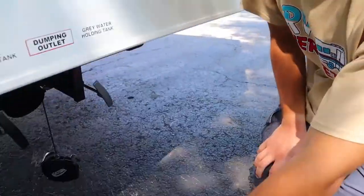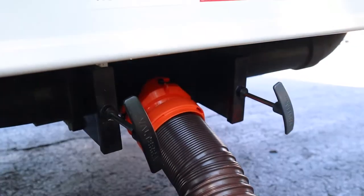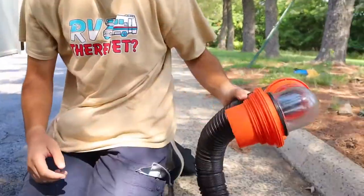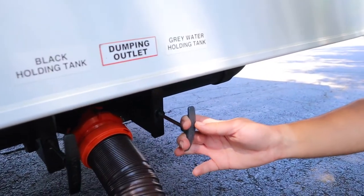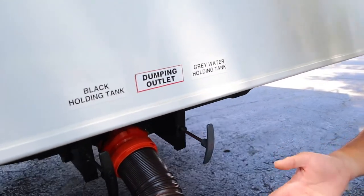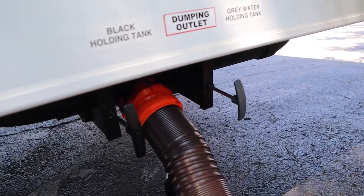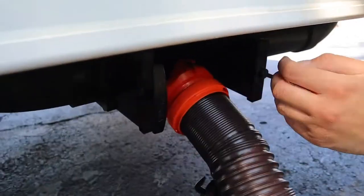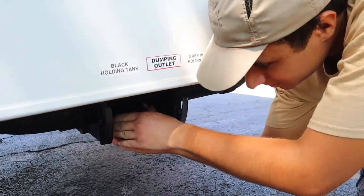Next to that you have the bag for the waste hose, which you will use to dump out the waste tanks. In the back here is your dumping outlet — this is where you dump out your gray and black waste tanks. Take your sewer hose, take the part with the teeth and flip it on clockwise until it snaps on. Then take the other half with the 90 degree elbow and stick it in the ground at the campsite or dumping station. You have two color-coded valves: the gray valve for your sinks and shower, and the black valve for the black tank — that's your toilet. Once you pull it out it's open and the waste comes out due to gravity. We recommend pulling open the black one first and then the gray one to flush it out. When done, push them in to close them, unscrew the hose, and put the cap back on.